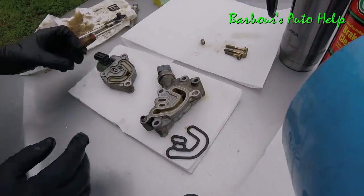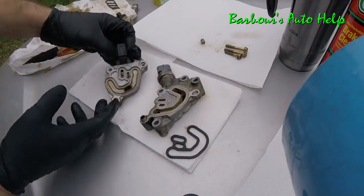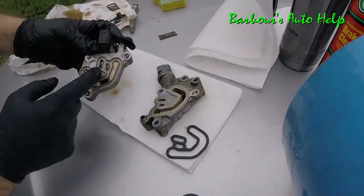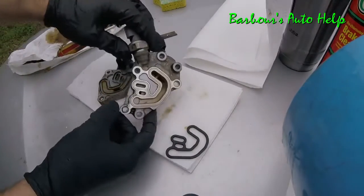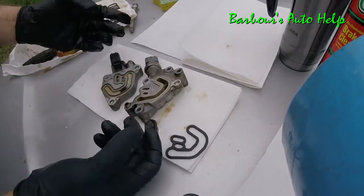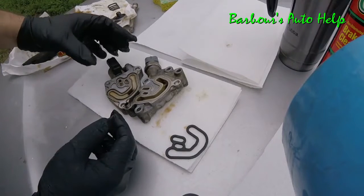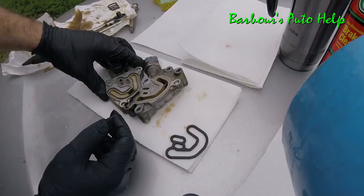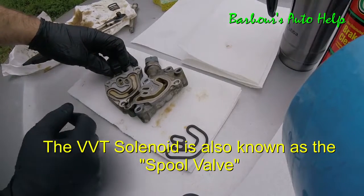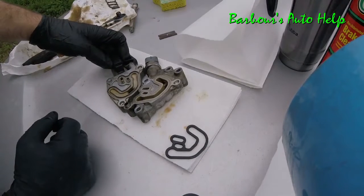Okay, just a little side note, guys. When I refer to this thing as the VVT solenoid, it's actually a compilation of several different parts. You got your solenoid right here, and then you got your spool valve inside there. And you got your other part of your housing where your pressure switch goes into. When you go to buy this, you tell them that you need your VVT solenoid for the back head, and you should get this part here. And I should have a part number down in the description below to help you out when you're trying to buy this.